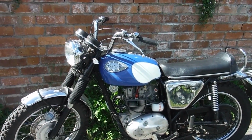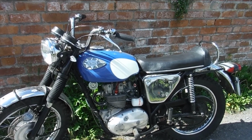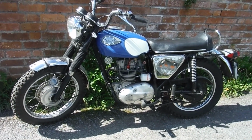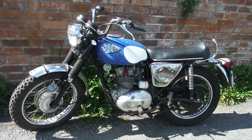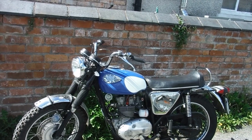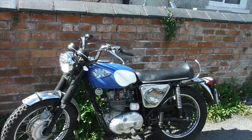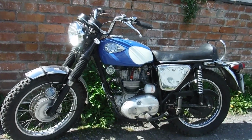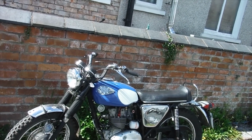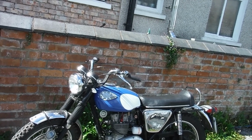I'm going to mark the ignition timing where it is now because I'm certain it's where it should be, and then I'm going to back it off a little because I did have it running later than this on what turned out to be C15 and Fleetstar timing, but I advanced it up to what I found and think ought to be the suitable timing for this before the high compression piston went in, but it just hasn't got the punch from low revs that I would expect, especially with the high compression piston.